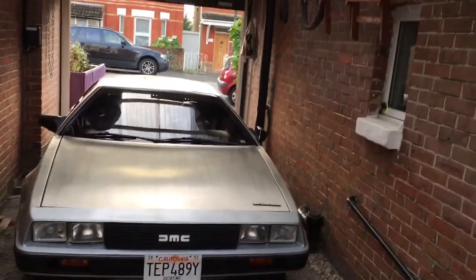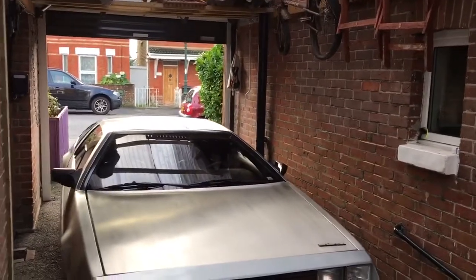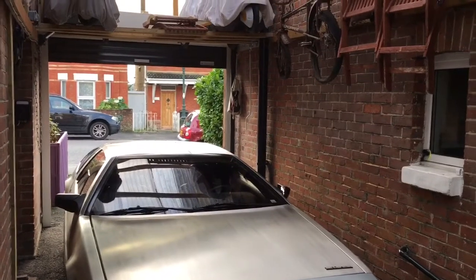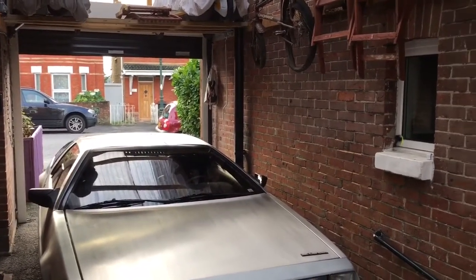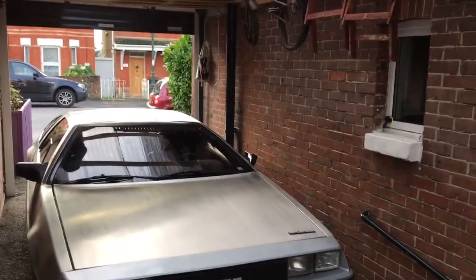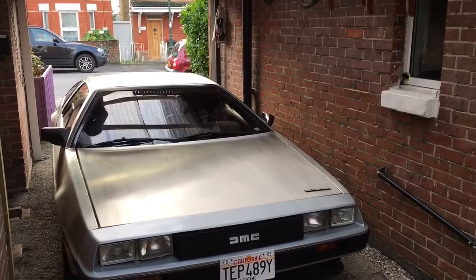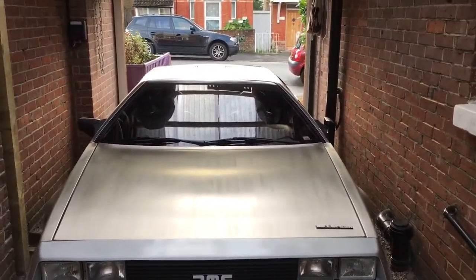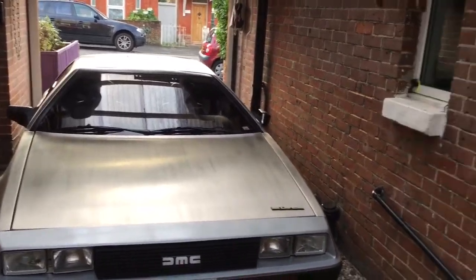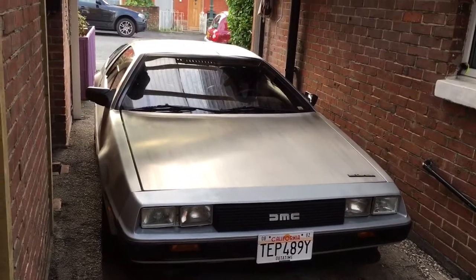You saw in the previous video that I checked the dwell. I'll refer back to my book tonight to see if that's the right level — I think 35 to 45 might be ideal, but I was showing 32 to 39, which is pretty damn close. To be honest, the car sounded good and felt good, so I'll double-check the book but I'll probably leave it exactly as it is rather than making any fine minute adjustment that might not do much. But yeah, I'm really pleased with the system — quality system.